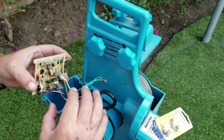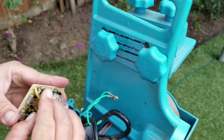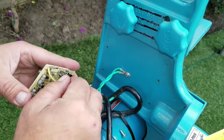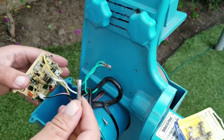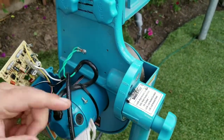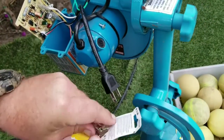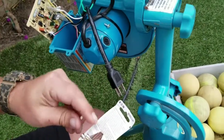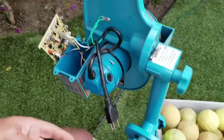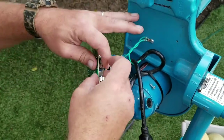Here's your burnt fuse — it's black. Fuses come in different shapes; this one in here has a squiggly center, these here don't, but that should be fine. This is a four amp fuse, and these are five amp replacements — they didn't have four amps at the auto parts store, so five should be fine. You don't want to go too small on your amps, otherwise it'll just burn again.